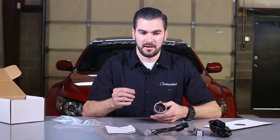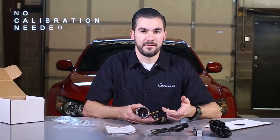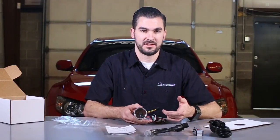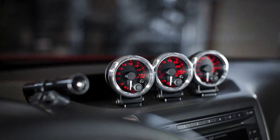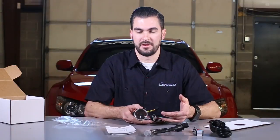There are also settable warning lights for low and high regardless of the throttle position sensor. A nice thing about this gauge is we don't require a free air calibration — we automatically calibrate the sensor every time you turn it on. Therefore there's no reason to do a pre-calibrated setup before or even during the life of the sensor; it will always calibrate every time you turn on the car.